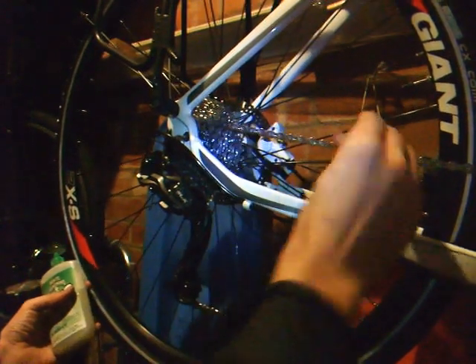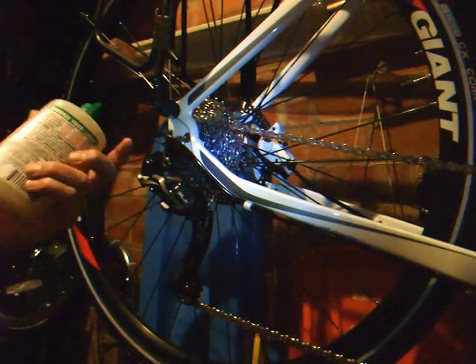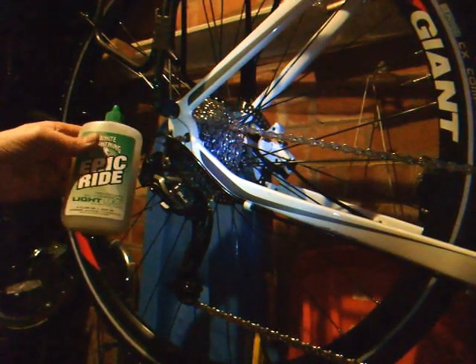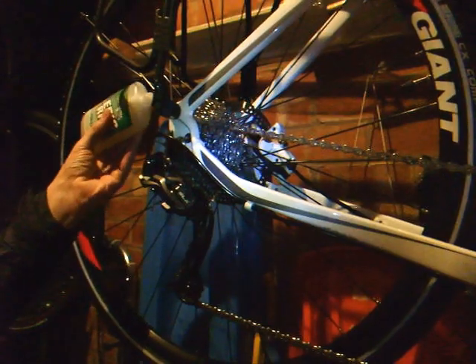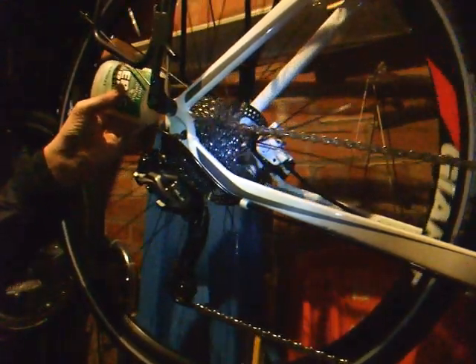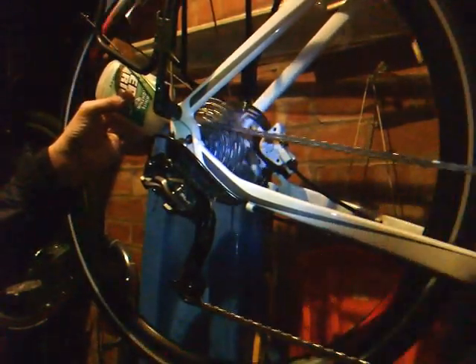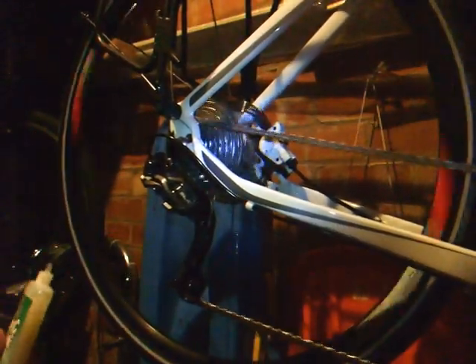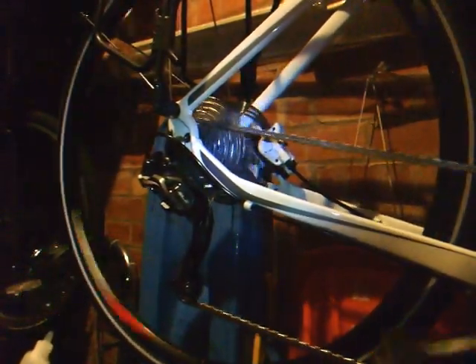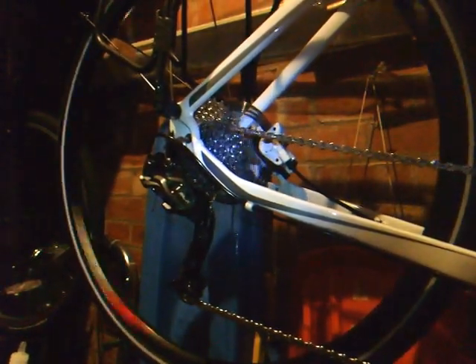As you can see the chain is absolutely clean. All we need to do now is lubricate it. I've chosen to use this Epic Ride lube — I quite like it, it's not too heavy. You do need to shake the bottle first and it is quite thin like water, so when you apply it you've got to be very careful. It just streams on, and that is it. Just carry on running the chain for a little while to let it soak in, and then it's good to go. All done.